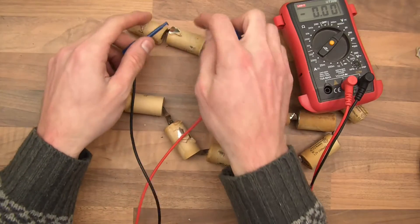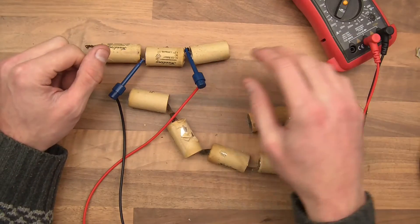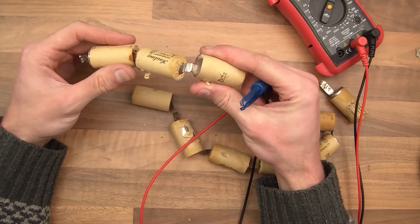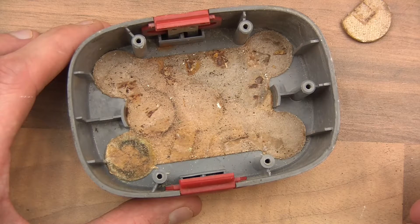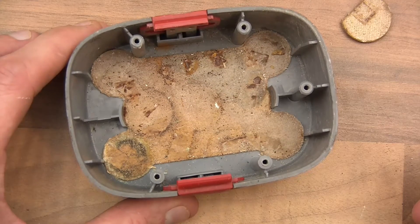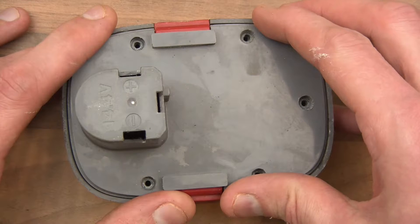It has got some charge in it. 1.3 volts, which means that's fully charged I would imagine. But it has no power anyway, so I think maybe the capacity is no good or something. I need to make some sort of way of linking up four lithium ion cells to this, and then to charge it up I'll need to do something with that too. Charging up is fairly easy because it's just a constant current method to charge it. For that I'll use my DC power supply probably, until I get a proper charger. I think that if I was to replace that with these lithium ion cells, I think I would revive my drill.